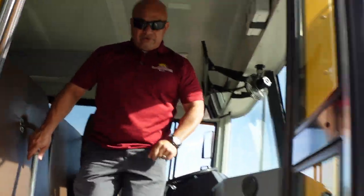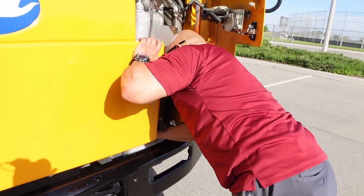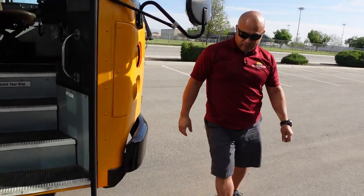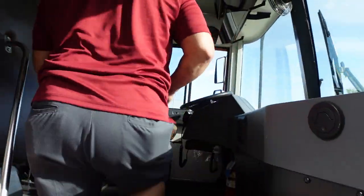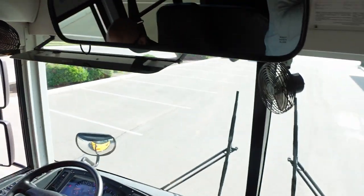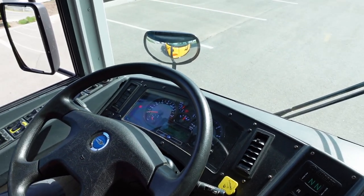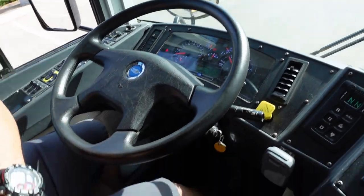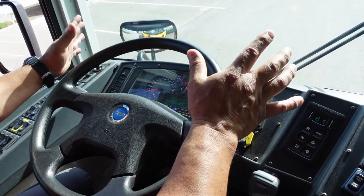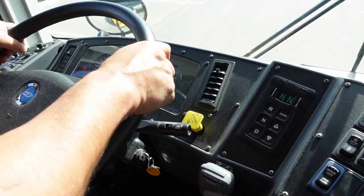I'm going to step outside and close the valve. I'm going to go ahead and start my bus. Make sure at any time you're moving the bus that your seat belt is on. I'm going to put my bus in gear, release my parking brake, let my bus roll forward, and apply my service brake. My bus stops. Next, I'm going to secure my bus and recharge my system to 100 PSI or a little bit over.